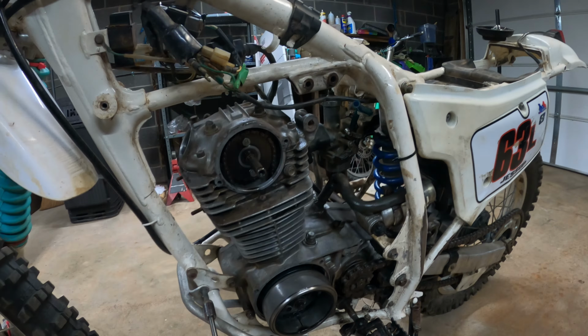Well, shoot, man. This thing's going to need a new piston. If you look, this guide, where the rings go, where they sit, it's fine. But right beyond the lip of the piston, it's completely gacked. Like, it's not there. It just came off in my hand. Ugh. How the heck did that happen? Looks like probably the ring overjumped it maybe and snagged it. Gosh, man. Dang it. That isn't what I wanted to see.